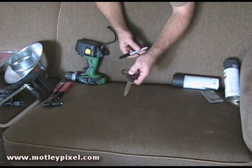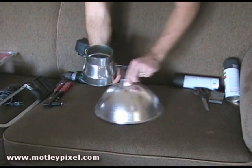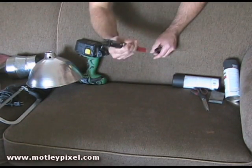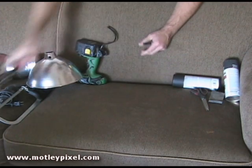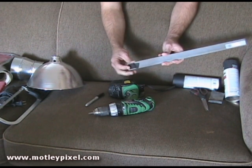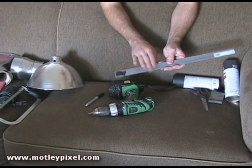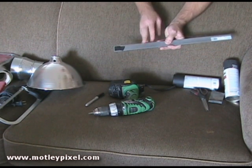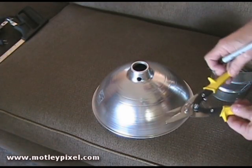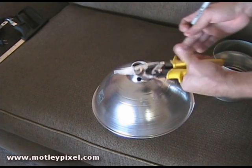You'll need scissors for the diffuser and a Sharpie marker to outline the hole, cut the hole, and pop the vent reducer through. JB Weld, sand, prime, and paint. You'll need a steel pop rivet gun with steel rivets and washers, of course, and a drill. I also have a small test sample here of hobby foam — I used contact cement and this hobby foam, which you can find at Michaels. You put it on top of the steel bracket to protect the camera and keep it from shifting left and right. And one thing I left out of the material introduction: tin snips — metal shears. You're going to need a pair of those.